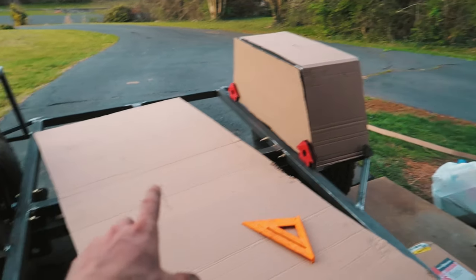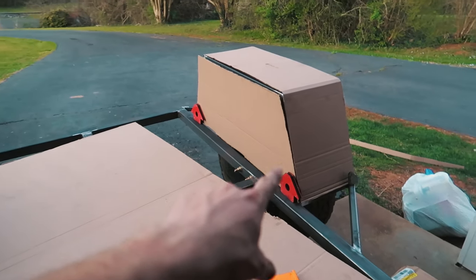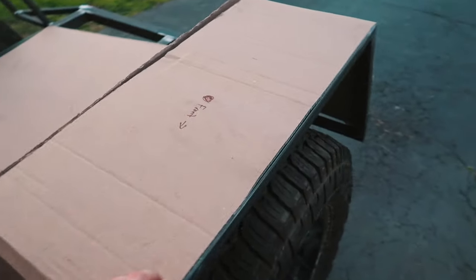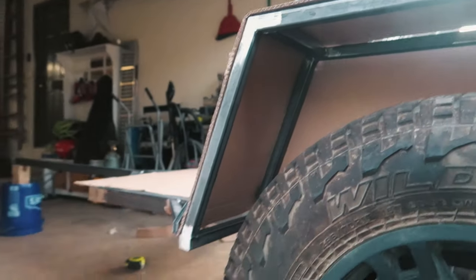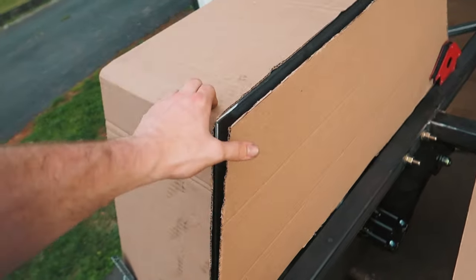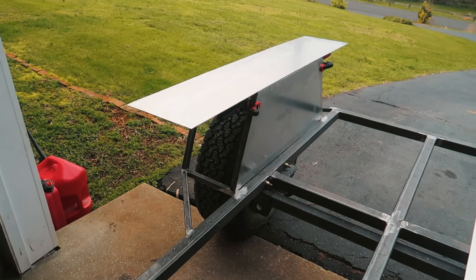What we got here is I've taken some cardboard and I'm creating a template because I'm going to be cutting these out of aluminum sheet behind that cardboard. I'm going to attach them to the fender braces that are already welded up. I wanted to get a template out of cardboard so I can lay it out on the aluminum sheet, see the best place to cut it from, and just kind of see what I'm getting into.